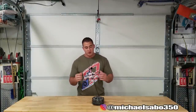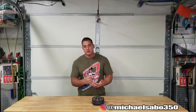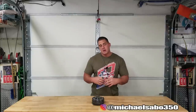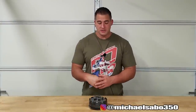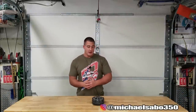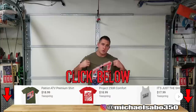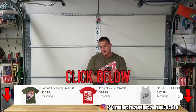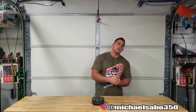All the steps we took today to set up this clutch basket may seem a bit excessive - you could just throw everything together and it would probably operate. But taking the time to sand down your clutch discs, soak your clutch plates, use the correct amount of Loctite, torque your bolts, peen the bolts - all that stuff sets you up for a clutch that's going to perform optimally, last a long time, and be reliable. I'll have all the parts and part numbers in the description below for this clutch setup, along with a link to this Hinson clutch basket and all the tools necessary to do the job. Our cases should be back from DBC Racing probably early to mid next week and we'll get to building the bottom end. Don't forget to check out the Mike Sabo merch - all proceeds go to helping out the channel. Have a great weekend, stay safe, stay sickness free, and I will see you in the next one!